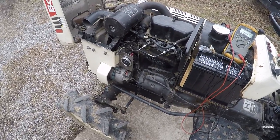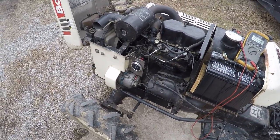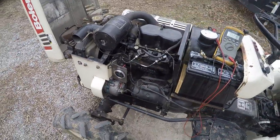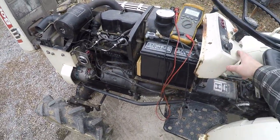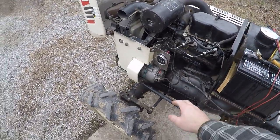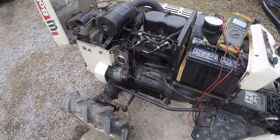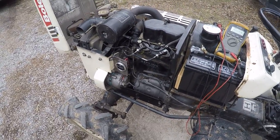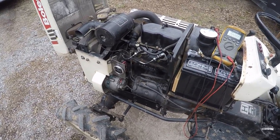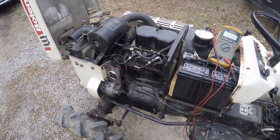More to the point, this is just to show how you can hook up a fast hour meter. You might even want to get one of the small square ones they have on eBay — that way you can cut a square hole and put it up on the dash, or into one of the side panels if you want to go that route. Just thought I'd share this for those looking to put hour meters on these, because it's really hard to keep track of hours just by memory. Hope it helps. Thanks for watching.